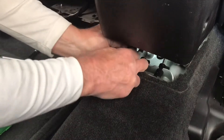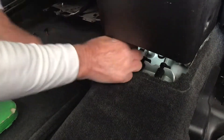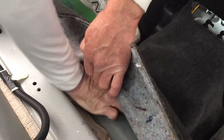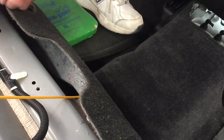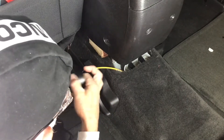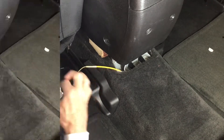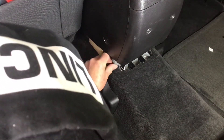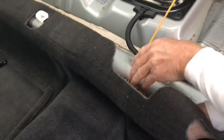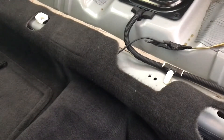This is a section of fiberglass rod that I use for fishing electrical wire in walls — a coat hanger or something similar will work just as well. You can see two steel cables to the right which are for the emergency brake, so keep away from there so the USB cable doesn't get tangled. The molded carpet is stiff — don't be afraid to pull on it, you won't hurt it. You need to create some room to slide the USB cable underneath it. When attaching the cable to the rod don't be shy with the electrical tape — make sure it doesn't come off. Work both ends: one hand guiding the cable and the other hand pulling on the rod. If you're in the right spot it should be easy to slide through.